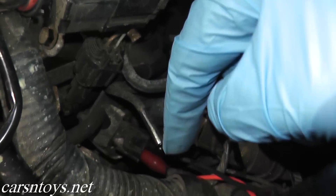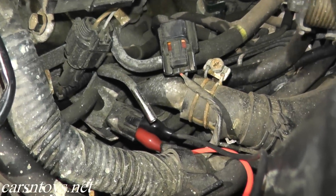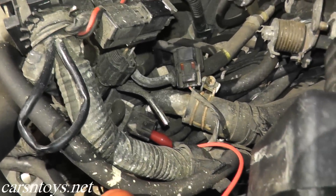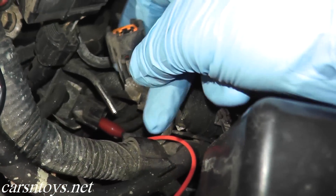As you can clearly hear, the valve is working correctly. Now if the solenoid valve in your case is not making any noise when you do this, you've quickly pinpointed the problem — you need to replace the valve. But let's say that it is working correctly but you still have trouble code P0443. That's just one thing to cross off the list — now let's look at the next thing.